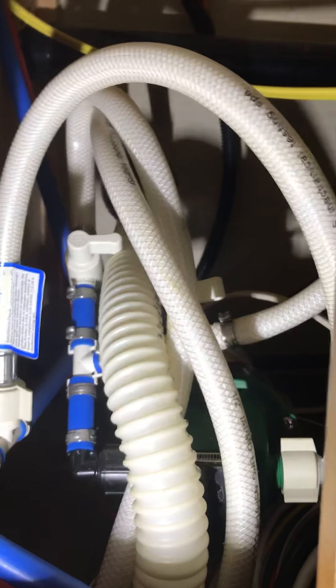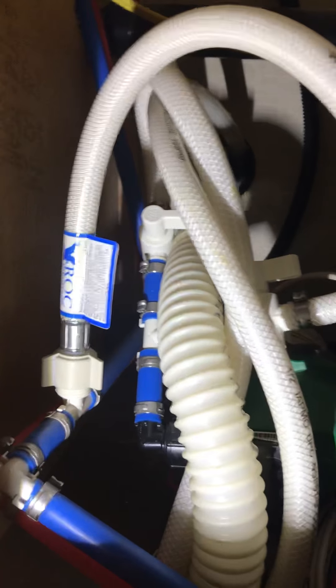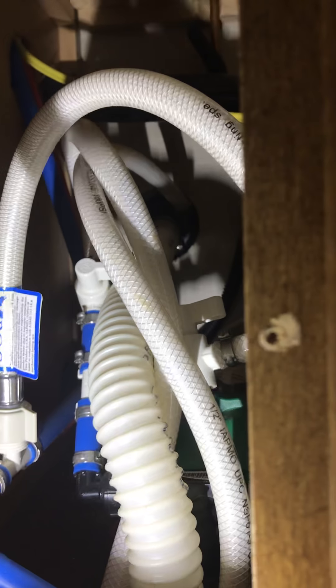The other thing you need to do is find your pump for your fresh water holding tank, and you have a couple of bypasses on it. One opens and closes this hose, which goes nowhere — that's what you're going to put in your jug of RV antifreeze. The other one opens and closes the line that goes down to your holding tank. So you're going to close the one that goes down to your holding tank — that's this line right here on mine — and open this one.